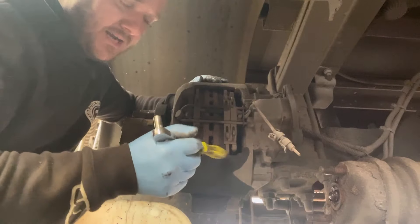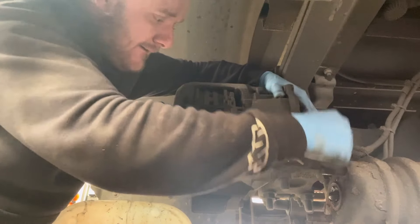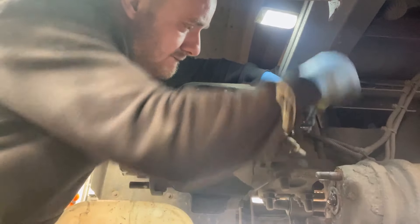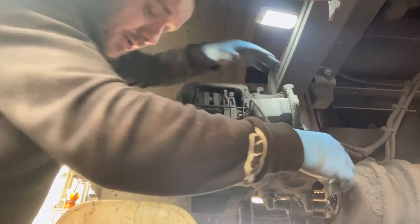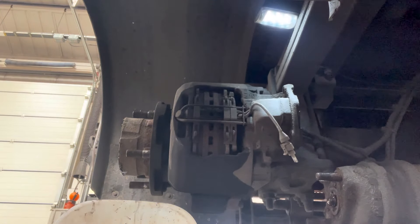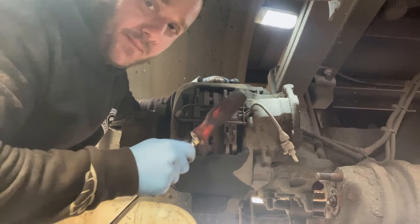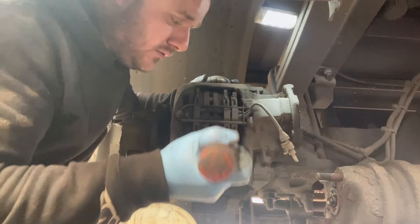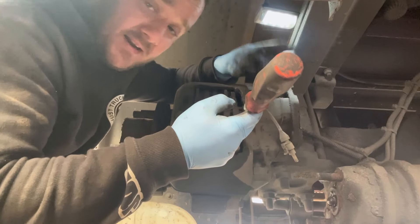I'm not going to wind all mine off - what I'm doing is just leaving the pads in the caliper and pulling it all off as one. Bit heavier but don't worry about that. You can see the piston moving in. When I'm replacing the pads, there's a plate here and if you go so far back, the piston can come out of line - you've got to line it back up in the little slots in the back of the pad. So what I do is when I'm de-adjusting them fully, I get a little screwdriver in there, put a bit of pressure so it pushes back with the piston, and then you know you're lined up.